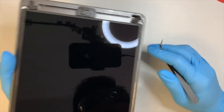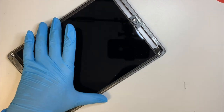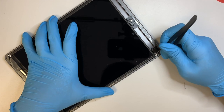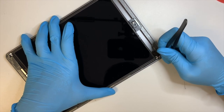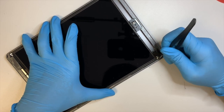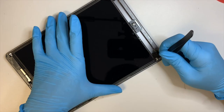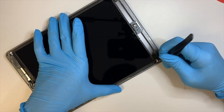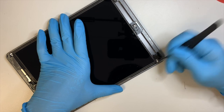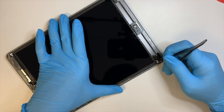At this point, removing the four screws doesn't remove the LCD screen. So go ahead and get a tweezer, something like that, to remove this black glue. And if you know the reason why Apple does that, please comment below. I just find it hard to believe that you already have the four screws that screw onto the LCD, and why do you need the black glue that glues the LCD still. So I don't get that part, but if you know the reason, please comment below.